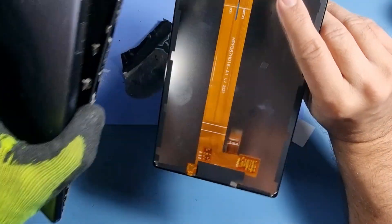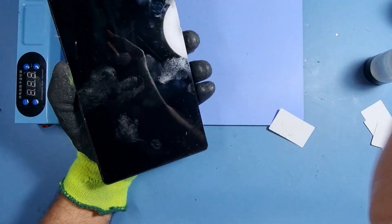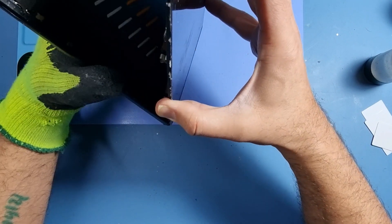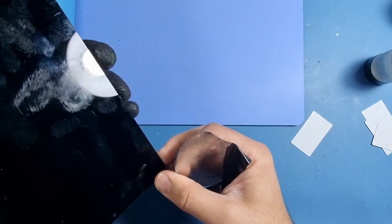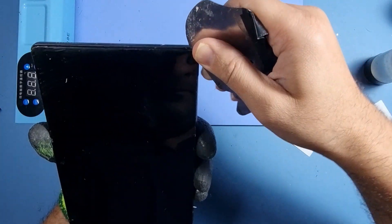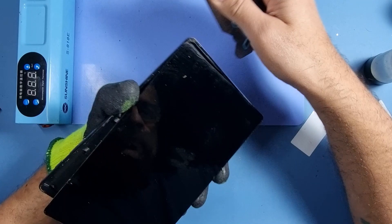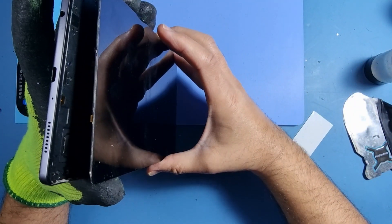Now this new screen, you can see the flexors are at the bottom. So there's not really much chance that you can damage it, unless you're actually removing a working screen. Do this a bit slowly — we don't want to damage anything else. Okay, I'm getting behind the frame, but I don't want to get behind the frame — we'll need that frame to be intact. As you can see, it's now separated.